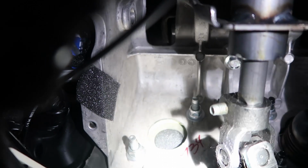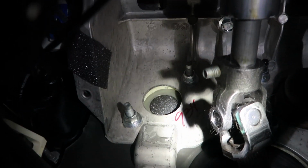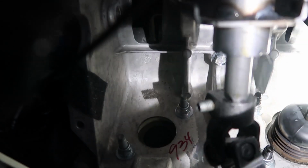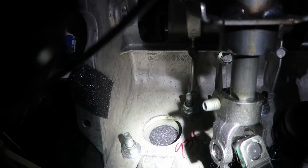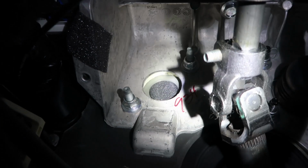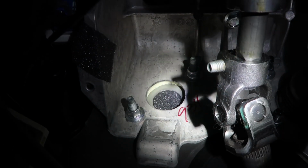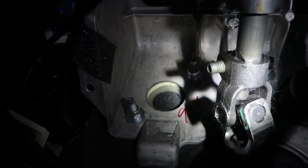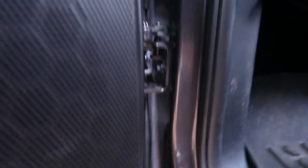So you can definitely put a clutch in this car. That's strange, there's an option for a clutch. That's pretty cool. So yeah, we can just drill right there because I don't plan on doing a manual transmission swap anytime soon. I'm going to put 2 holes because I'm going to run the remote wire through the firewall as well, and just connect it to the fuse box. So that's going to work out nicely.